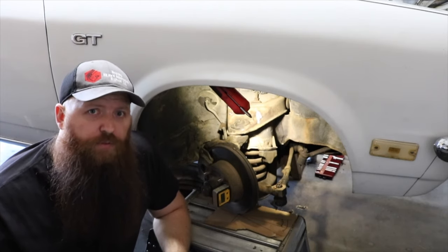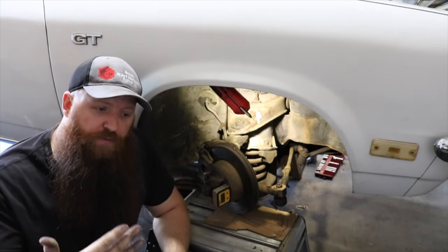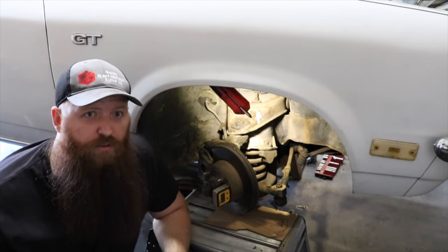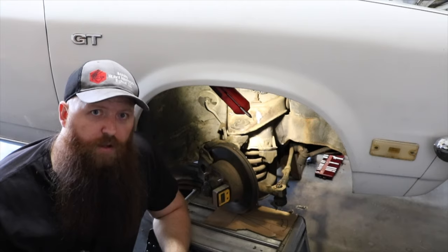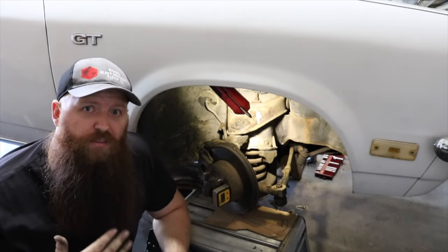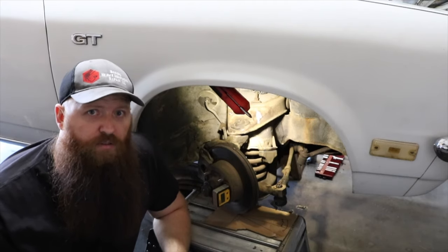They like to have self-steer, or whenever they are drifting one direction, they like to have the car switch back to the other direction kind of on its own. I would like to have my car do that as well. And in order to do that, you need to dial in quite a bit more than the stock standard amount of caster that's available on the Vega.